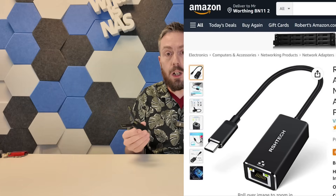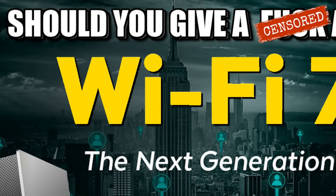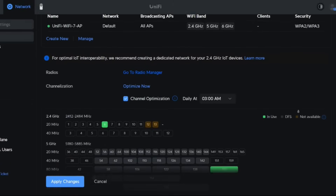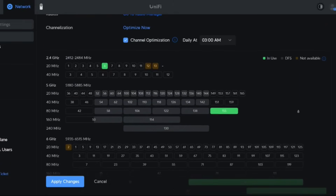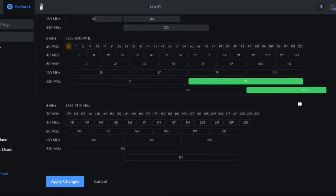Why is Wi-Fi 7 able to give even better performance than some USB to 2.5 gigabit ethernet adapters? A large part of that — and we covered this in a larger video about whether you should care about Wi-Fi 7 — comes down to two main factors. Number one: frequency. Wi-Fi 7 opens up the 6 gigahertz frequency band. Most previous Wi-Fi adapters give you access to 2.4 gigahertz and 5 gigahertz, and some tri-band adapters give you two 5 gigahertz connections. This adapter, on the other hand, is tri-band giving you 2.4, 5, and 6 gigahertz.